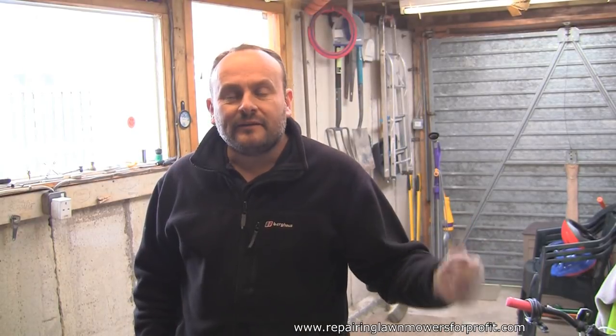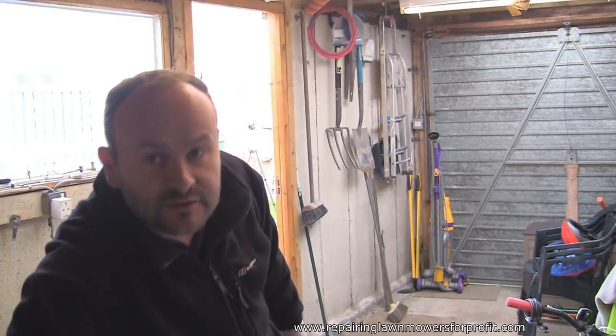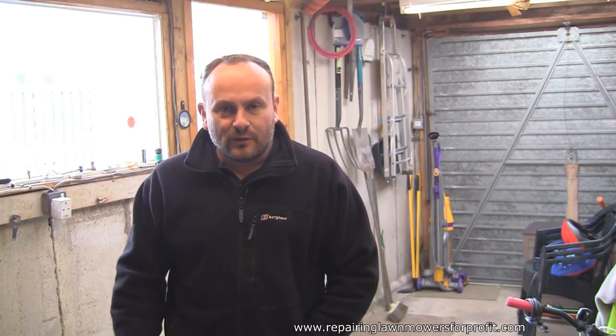So how about that then? A simple spark plug, just a simple change, putting a brand new spark plug in. I've mentioned this on loads of videos. I used to pick loads and loads of Honda mowers up from an auction centre. I actually talk about it on the Masterclass DVD that I've got. People had tightened these plugs in so far and they just wouldn't start. I used to bring them home, put a plug in them, and I could not believe they would start. I'm not even sure if it was a trick that people did at auctions. They used to go around the field and nip them all in, making sure they wouldn't start, to try and bring the price down of the auction.